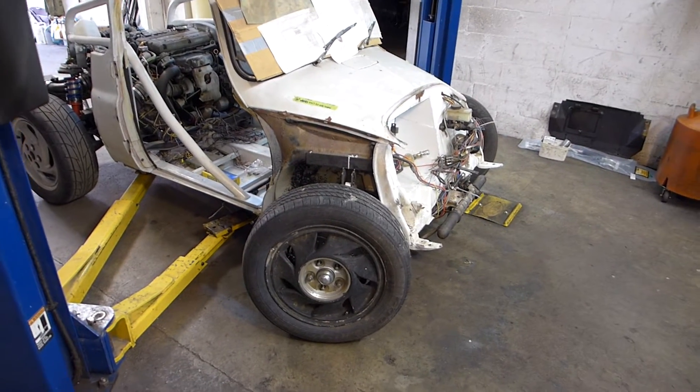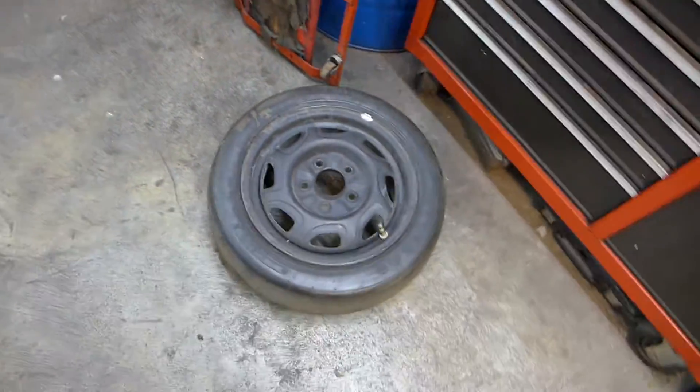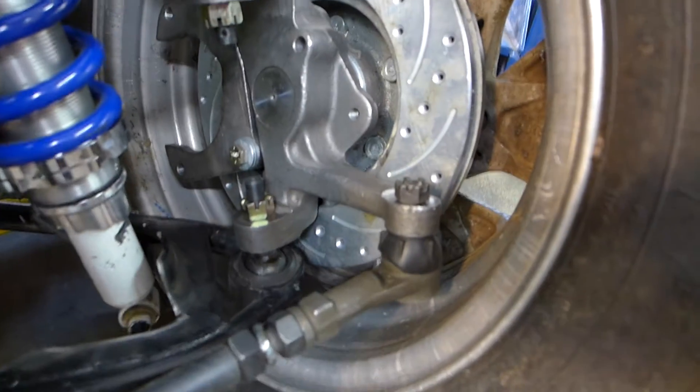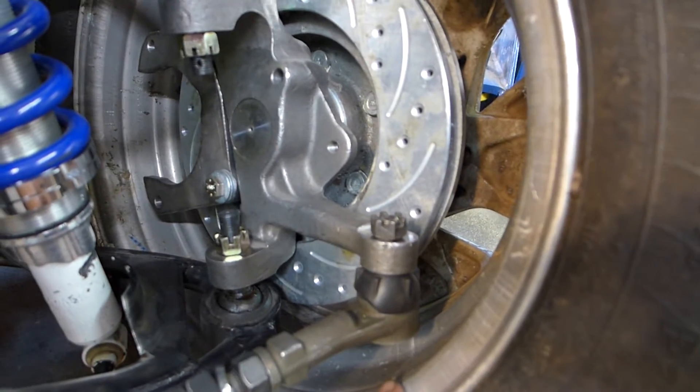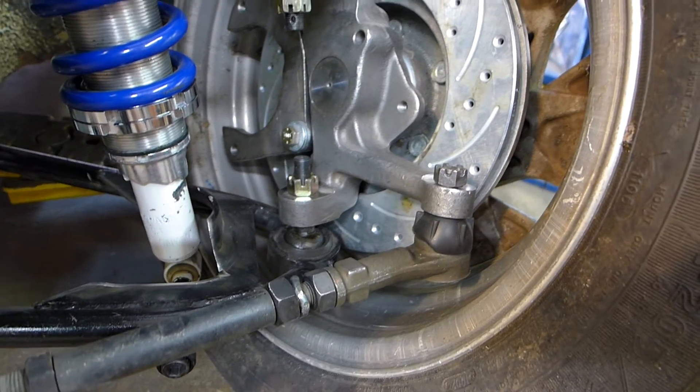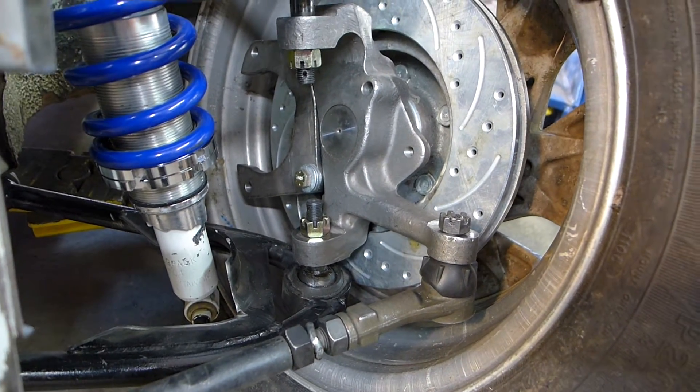The big wheels on there — they're not really big, they match the rear. Ultimately the car is going to get the 14-inch wheels, which I had on there prior. Those are definitely smaller, but I couldn't get my tie rod on the bottom with them — I'd have to mount to the top, and that would throw my angle all off, create bump steer, and some other issues. A lot of engineering goes into this; you can't just throw a front end together, as I am quickly realizing.